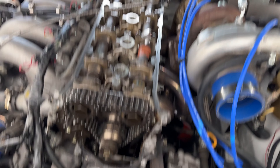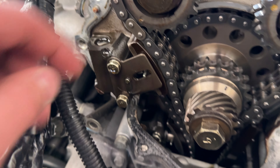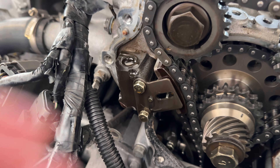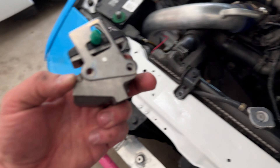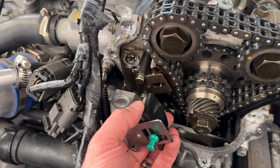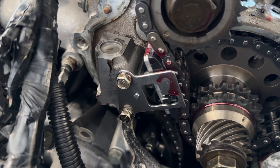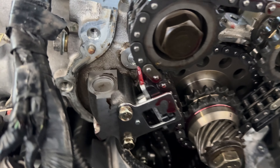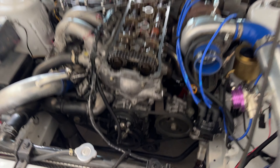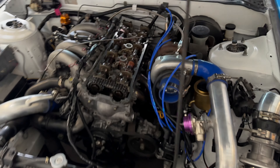It's all torn apart now. Basically this guy right here is what we're replacing. I'm just going to undo these two bolts and then swap it out with the new one. That's just going to go right there. This one was very clearly worn out. There's the new one in there, all installed. I put some assembly lube on there as well, so that should quiet it down. Front cover's back in place, so now I'm going to get all the bolts in and button it back up.